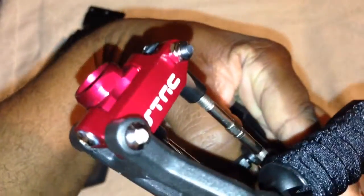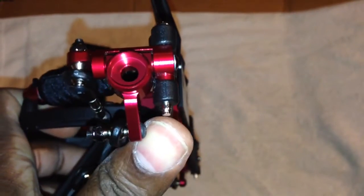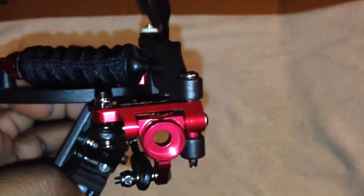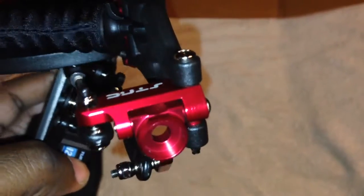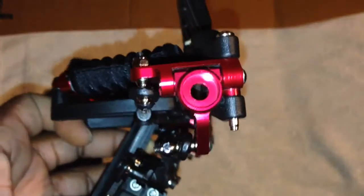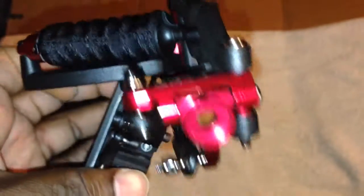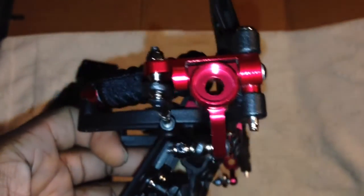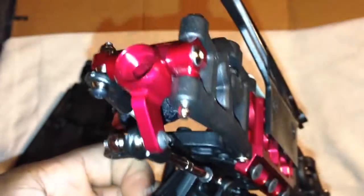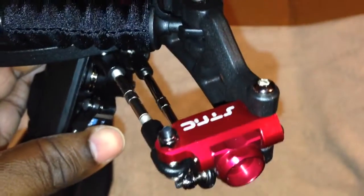Factory tie rods, knuckles, and block are aluminum. I had to drill the hole at the bottom wider to put the pin through — this is the factory pin that doesn't fit through there properly; the hole inside the block is too small. So I took a drill bit carefully, drilled the hole a little wider using the same diameter drill bit as the pin, so it's nice and secure with no wobble.